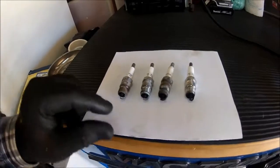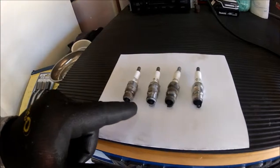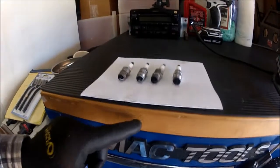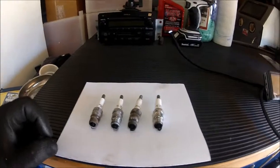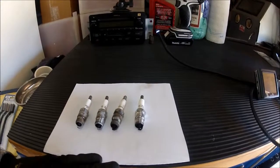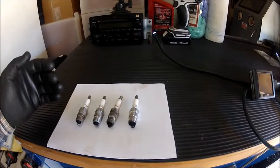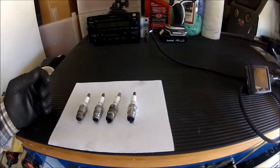So I'm thinking that it was probably corrosion that I saw and not really a cylinder running lean. If you've got a lean cylinder, you're going to look around the ceramic of the spark plug and it's going to be very, very brown — almost as brown as the maple top on my toolbox here. So anyway, I'm thinking the cylinders are rich. I'd rather have the engine running rich than lean because if it's running lean, you run the chance of burning valves — cylinder temperatures are going to be much higher.